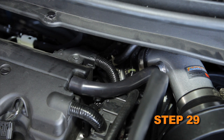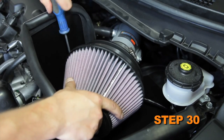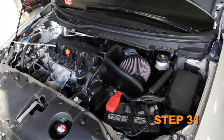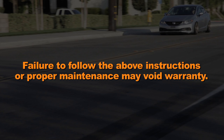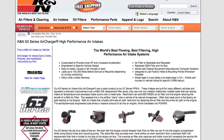Install the provided crankcase vent hose onto the vent port of the valve cover and to the fitting installed into the K&N intake tube. Install the K&N air filter and secure with the provided hose clamp. Reconnect the vehicle's negative battery cable. Double-check to make sure everything is tight and properly positioned before starting the vehicle. It will be necessary for all K&N high flow air intake systems to be checked periodically for realignment, clearance, and tightening of all connections. Failure to follow the above instructions or proper maintenance may void warranty.